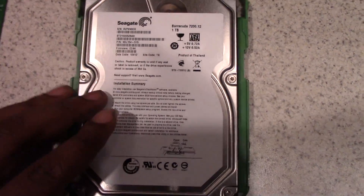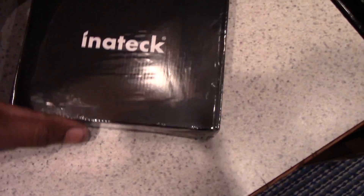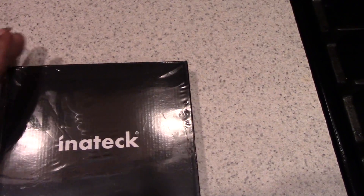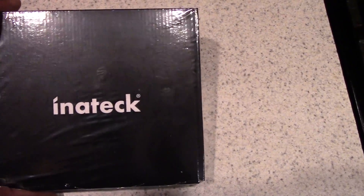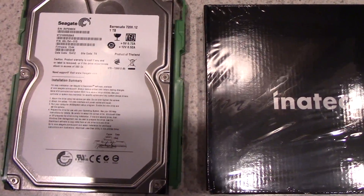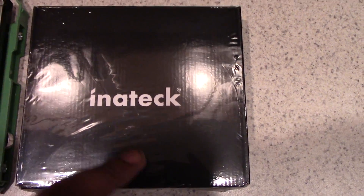The Mac Pro has four bays for hard drives, so it's one terabyte. And here's that Amazon package — I'll go ahead and show you guys what that is. There it is — Inateck. It's USB 3.0, because that old Mac tower only has 2.0 and I have two external 3.0 hard drives, so I'm trying to increase the speed. With this USB 3.0 card and this extra hard drive, I'll be able to increase my video editing speed — I can temporarily dump my video on here, then edit and export. This should speed up my two external hard drives.